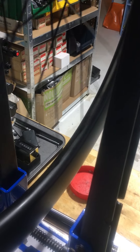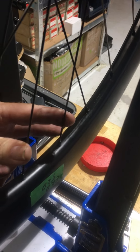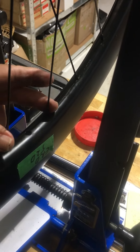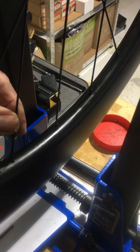The issue here is that these are parts brought to me by a customer — he brought me the hub and the rim. The problem is that the rim drilling, the nipple hole drilling, should match. In other words, it should be drilled to accommodate this. We see here that these two spokes on the drive side straddle the valve hole, and then we have one spoke non-drive side, two spokes drive side, one spoke non-drive.